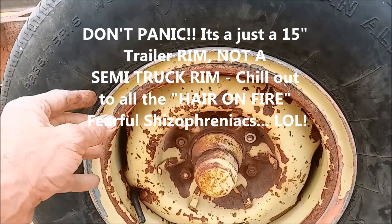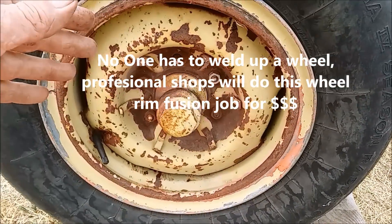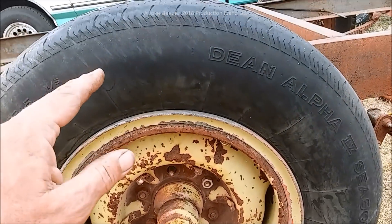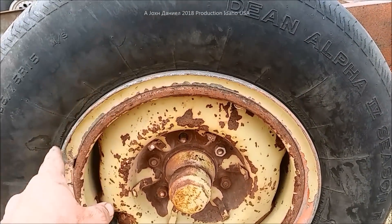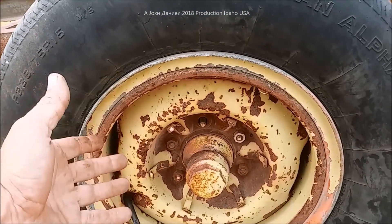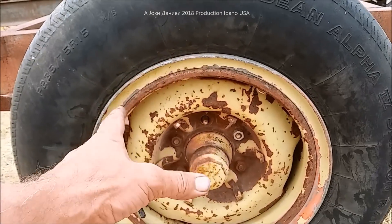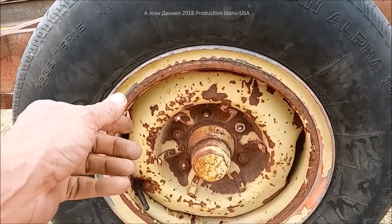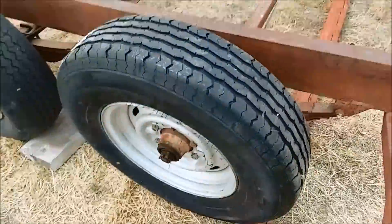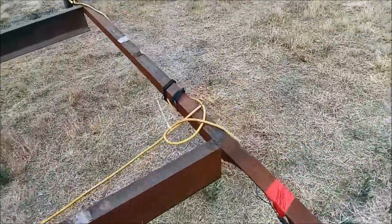I have a machine that will make and roll a piece of regular steel that we'll put in here and seam-weld it. Now they tell you don't weld on wheels — well, that's true — but how do you think a wheel is put together? It's welded. You can't weld on the spring steel materials; that's dangerous. What we're going to do is roll a bead all the way around it so it still requires a tube, but you can put it on with a regular tire machine and it will not pop off. Anybody interested in these very antique classic wheels from 1955 — let me know. We're actually going to go with the GMC Vandura wheels because of the 12-ply tires — it's just a much better deal.